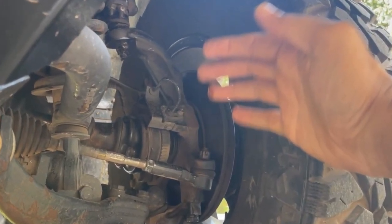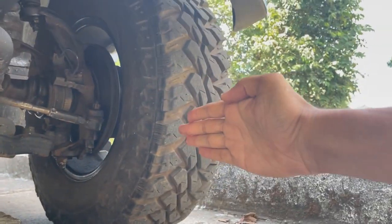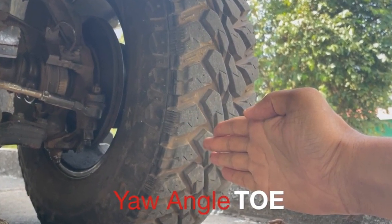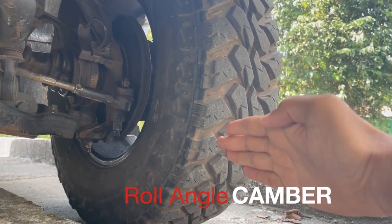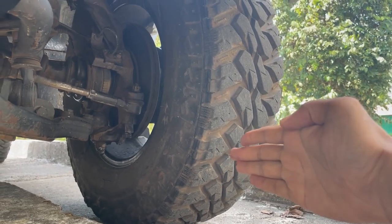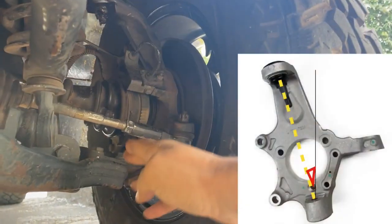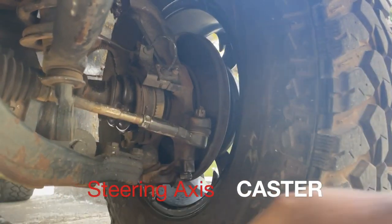During alignment we are trying to orient the steering knuckle within the wheel well cavity in three dimensions. To measure this orientation tangibly and uniquely, we define three different angles: the yaw angle of the wheel, called toe, which shows how much the wheel is in or out of line; the roll angle side to side, called camber; and the steering axis — a line connecting the upper and lower ball joints about which the wheel turns on steering — whose inclination to the vertical is called caster.